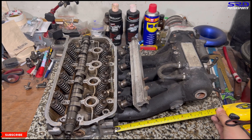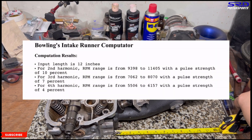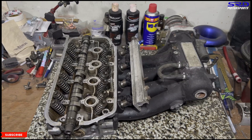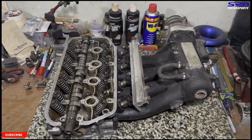The Skunk2 runner length is around 9.2 inches, and since the ports are 3.25 inches, it's around 12.5 inches total intake runner length. We've calculated it: with 12.5 inches total, the third harmonic falls between 7,062 and 8,070 RPM. Knowing this, you can make the exhaust, throttle, and intake pipe all work together in that range to pull good torque and good numbers — no need for extra-close gear ratios. We'll delve deeper into gear ratios and the RPM power band in a linked video — click the link in the description and finish this video, because we'll cover every single detail until we get the 13 seconds.